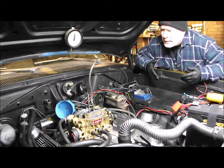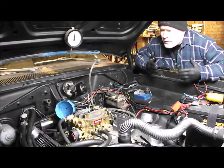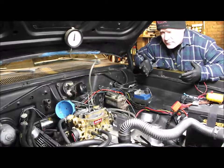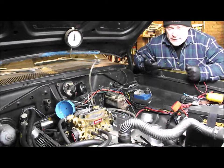So there's a lot of things when you have a car that's new to you that's really rough - you've got to go for all the basics. Three basic things really: mechanical, make sure the mechanicals are okay. I've done a compression check, the compression is good. I believe all the valves are closing - the compression check confirms that.